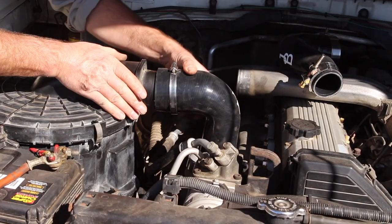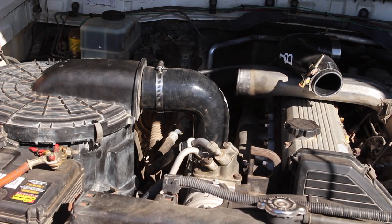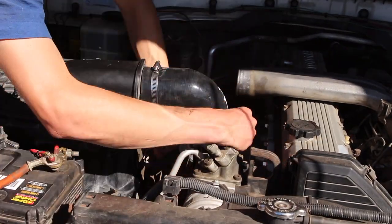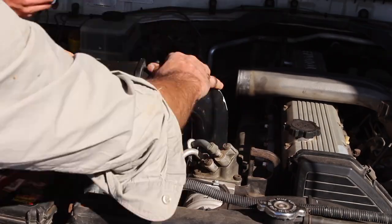To make these silicone hoses fit, I actually had to change the angle of the airbox lid. This wasn't a big problem. Some of the clips didn't grab quite like they used to because they weren't made for that spot, but it was pretty easy just to put a little bit of rubber hosing or fuel line on top to make them sit nice and firm.